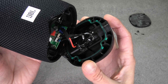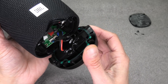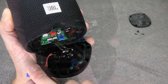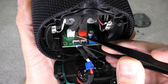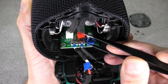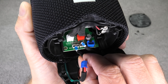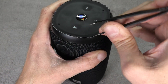We want to do this carefully because there are a couple of wires and cables here, and we don't want to accidentally rip those off. So we really detach the blue connector here — that's really easy. Then we have those two ribbon cables. If you look carefully, you see these gray levers. Just push those up — I'm using my tweezers to push those up — and then I can easily remove the ribbon cables. You really don't want to accidentally break those ribbon cables; they're difficult to replace.